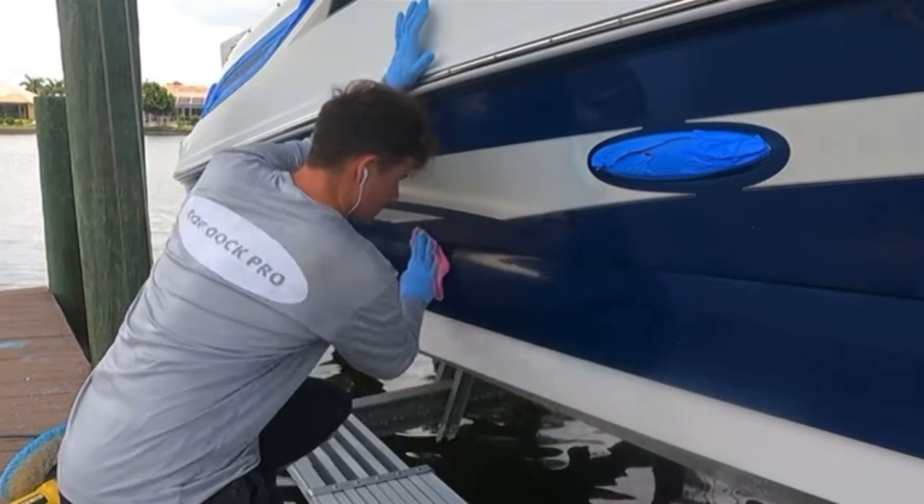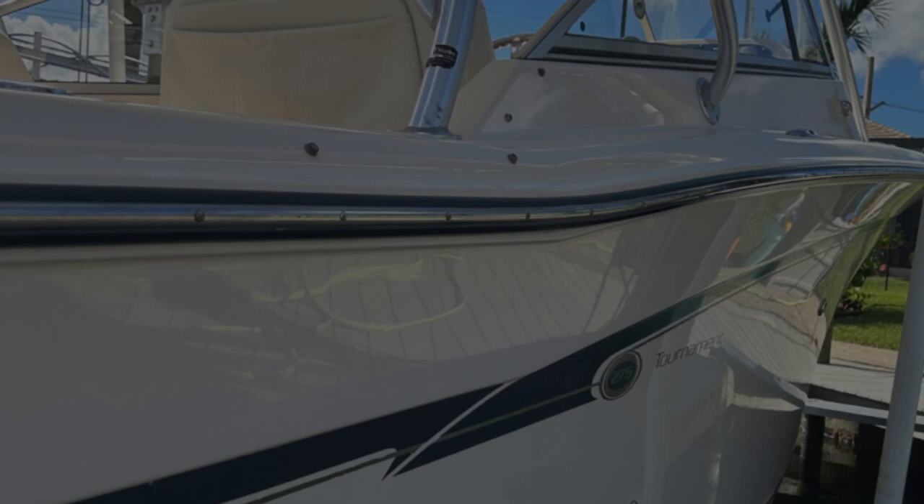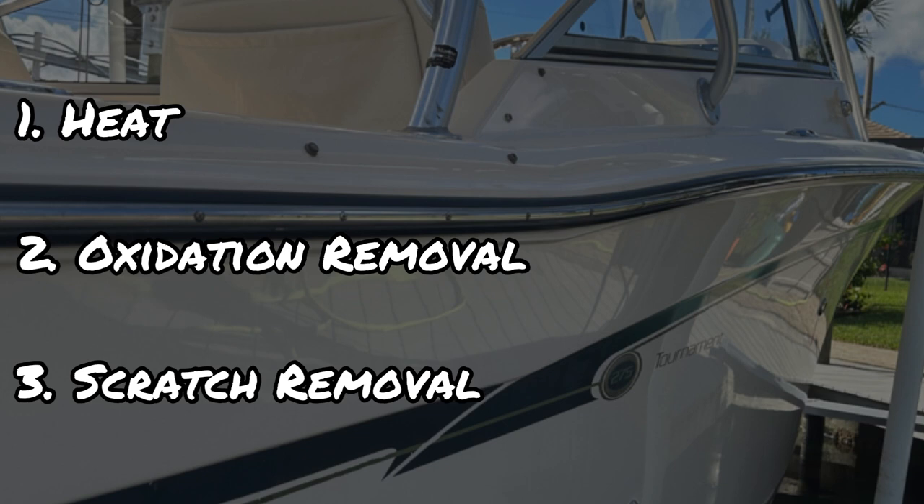This is a great overview of the basics. When you're running a heavy cut pad, we want to stick to heavy cut compounds because that is what the pad was intended for. So Stark Level R, Ardex Super 600, Presta Supercut, 3M Heavy — these are going to be your best options when running this pad. We don't want to run polishes or waxes with this pad, or we're going to run into a lot of issues with swirls. Always use this for heavy cut or medium cut compounds.